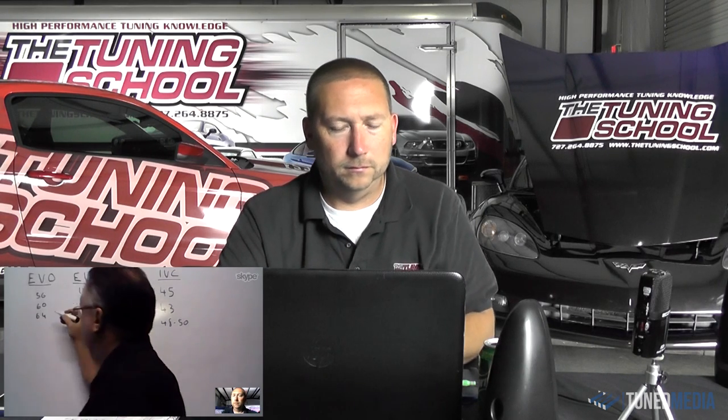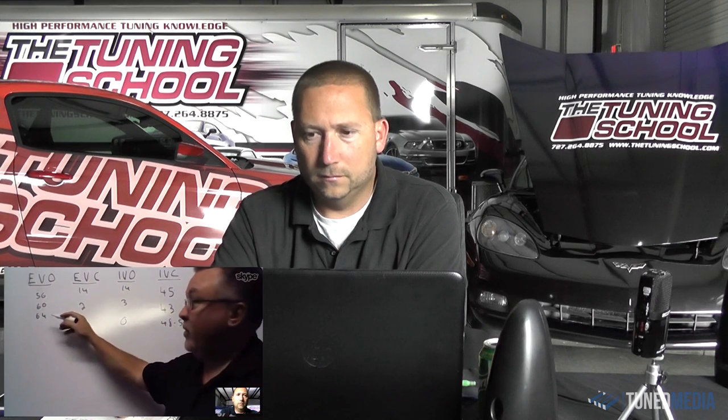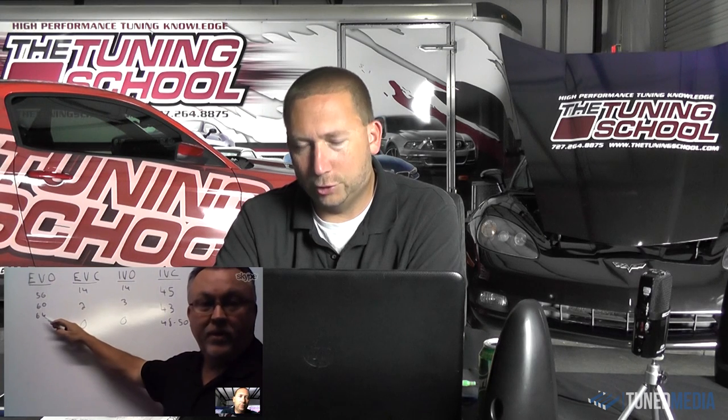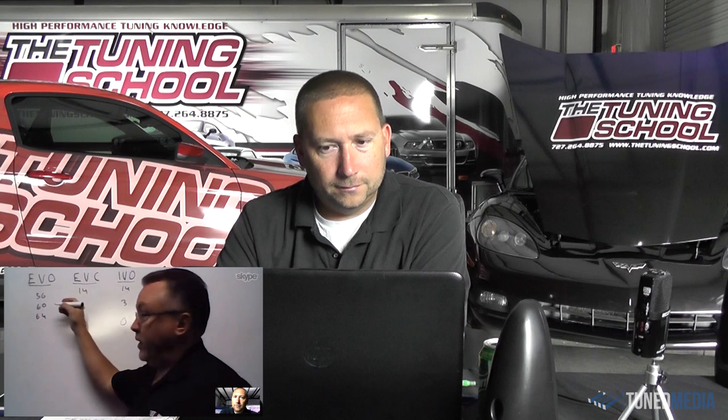Sure. A few years back, we wanted to test a bunch of naturally aspirated LS3 camshafts, and I wanted to know some very specific things. One of them was, if we had exhaust valve open events of 56, 60, and 64, how does that affect power on a dyno? Because to give you the rest of the numbers here, those exhaust durations